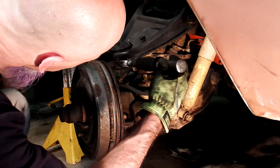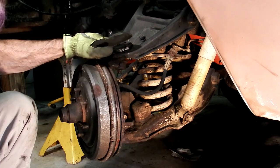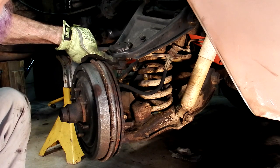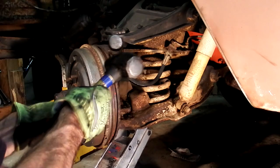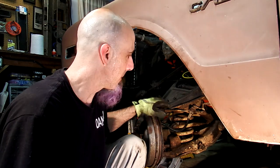Now on these ball joints I like to use the pickle fork and my big friendly hammer. I'm actually going to jack this up a little bit because it will give me a better angle to get in between here. Now this is a rubber boot so you want to make sure that you don't tear this boot up if you're not replacing your ball joint, or you will be replacing it. For sizes, 3/4 was the size of the nut on the upper ball joint, also the nut and bolt on the bottom of the shock. The top of the shock outer was 3/4, but the inside - because it's a stud that goes through the chassis - it's actually 15/16. I just put a wrench on that.